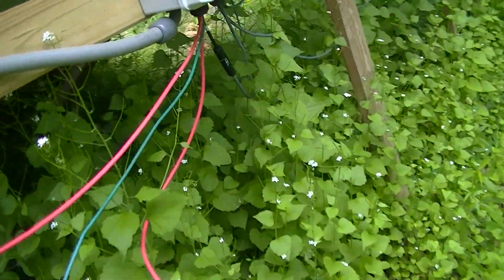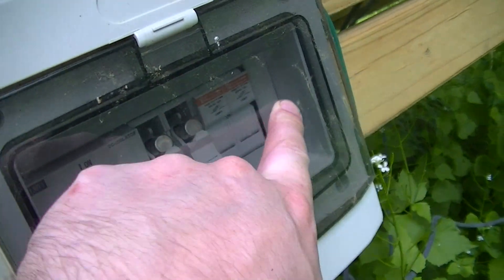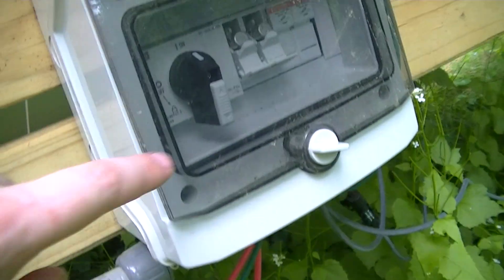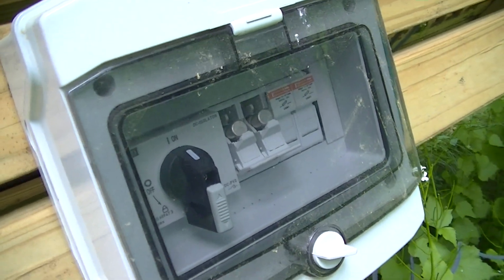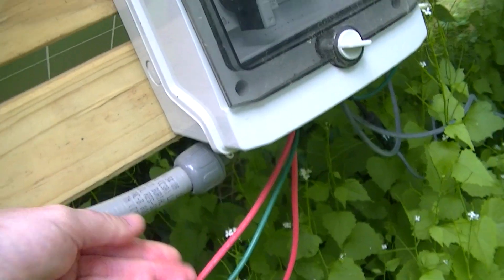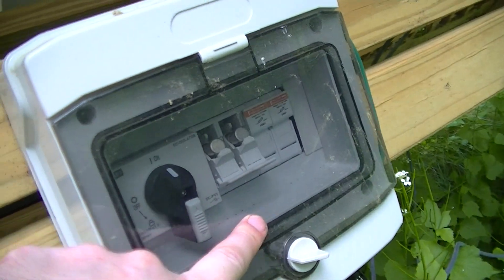This is why, as another building tip, it is very useful to have string-level isolation. That's why I have fuses for each stringer module down here, even though technically it doesn't need it because there's only two strings on this particular home run. It means that if there's something wrong with one string, I can just isolate that one string.